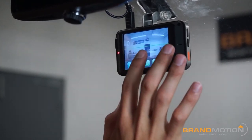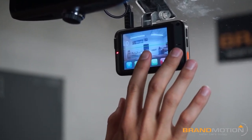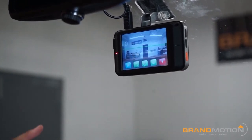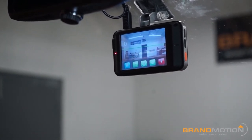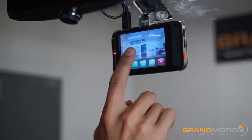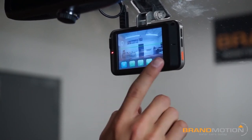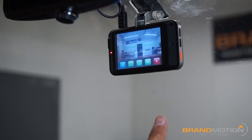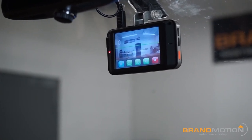Back on the home screen, you'll see the green line with no cross in the middle. Now we're going to go drive it around and it will automatically calibrate. We're looking for straight roads with good lane lines. When the calibration process starts, you'll see a red cross in the middle of the screen; it stays there until calibration is complete. Then the arrow turns blue and you'll get an audible tone.